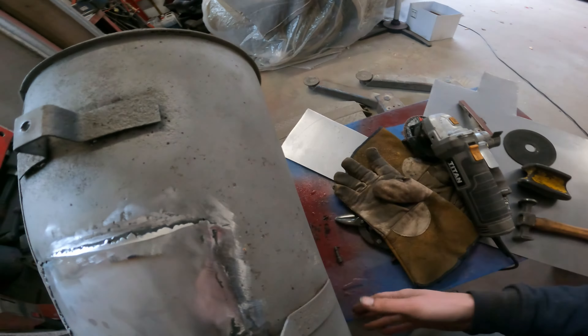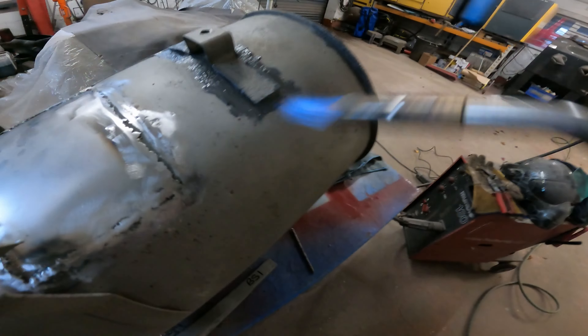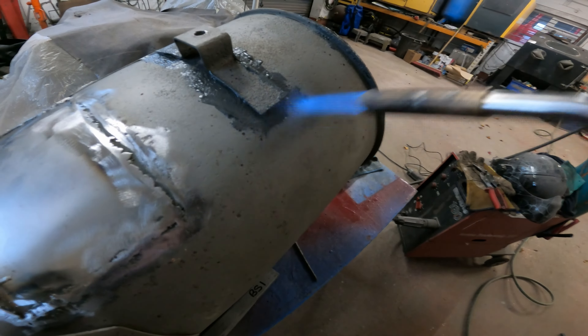First you make sure the material is clean, no paint and stuff in the way, no paint and rust. This isn't because it's been shot blasted. You get your solder paint. This is solder paint. People just call it flux, solder paint, whatever you want to call it. Paint it on. It's like a grey paste. I'm just going to show you quickly what happens. You warm it up, it'll start to flow and go silver and then you wipe it off with a cloth. You warm it up until you see it starts to bubble like that. The thing I want to do is wipe it off because it's hot. I'm going to re-flow it and then wipe it off. So that's it all tinned up - tinned, fluxed, solder paste, whatever you want to say.